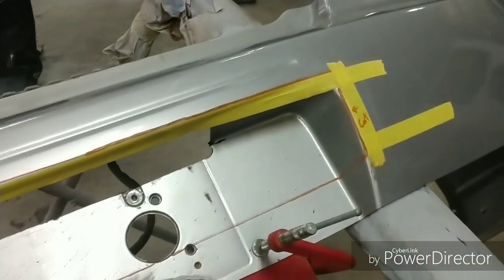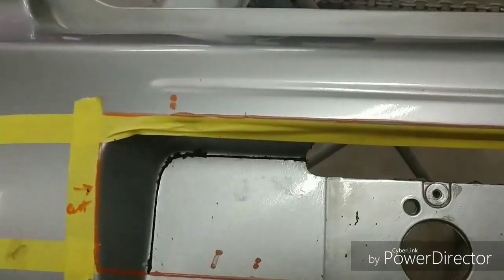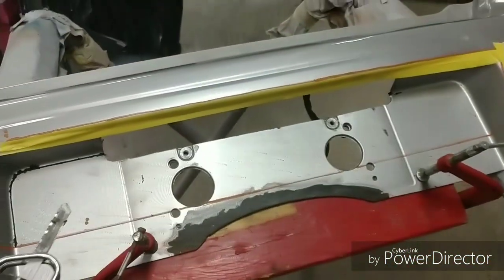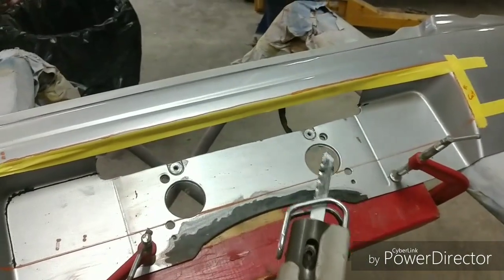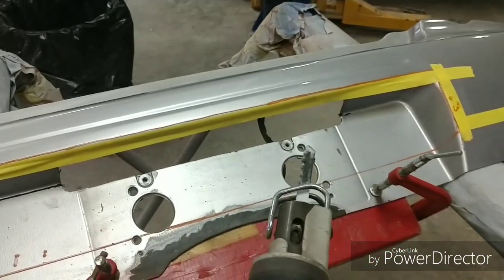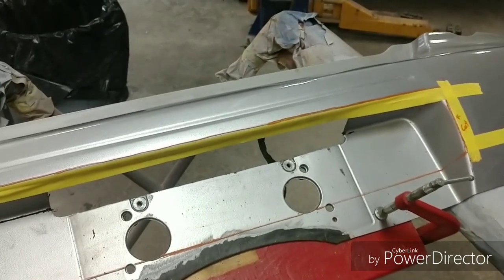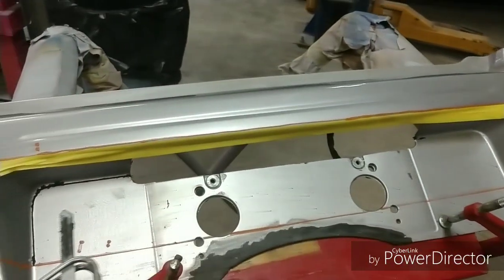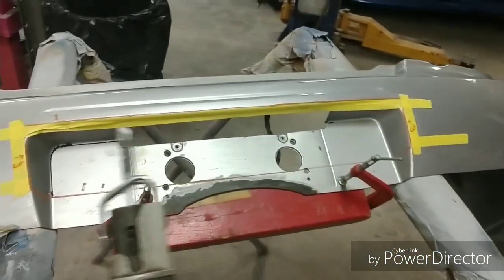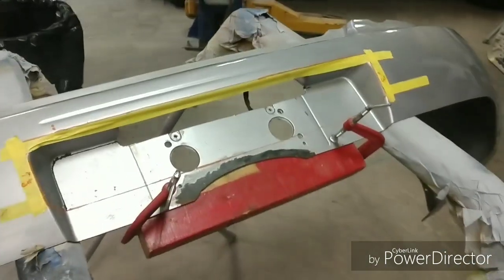Anyways, long story short, we're going to go ahead and move on to the next cut over here and get that done. You can already see I've gone along the body line. We're going to cut out that flat portion here, and believe it or not, we're actually going to use that. Now, we can fill these little coin sections in here and make all of these nice and solid. We'll go ahead and take that threaded bung out of there, and we will make this a nice solid flat piece of plastic, which we will then use later for the base section to be the filler. So you'll see how it turns out. For now, let's just cut this out.